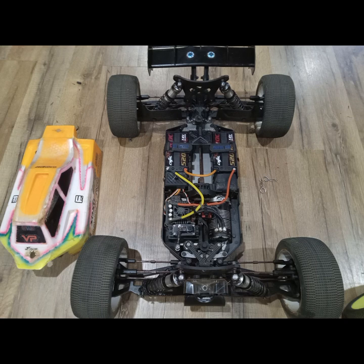All right, guys. This is also a Serpent 811 TTE, which is 811 Truggy Team Edition. Now, this one came with the, I think it's called conical or spiral cut, kind of slant cut gears instead of the straight cut gears that the other one came with. Now, I did upgrade the one in the rear. I failed to mention that earlier, so I'm letting y'all know now that one does have the upgraded gear in the rear.